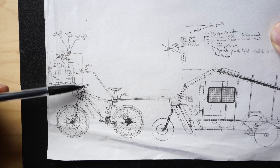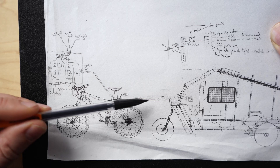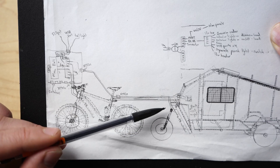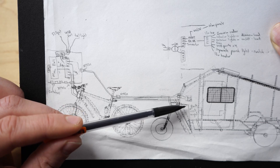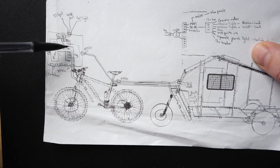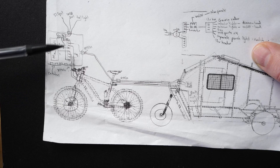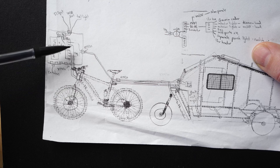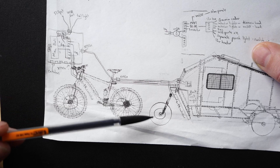The wiring will run along the crossbar to the connection point above the hitch, then all the way back to power the Frankenrunner controller, which powers the CyberDrop front hub motor. Also splitting off the same circuit, I'll feed into the CyberDrop another step-down converter for the 12-volt system in there. The second circuit will power the front Frankenrunner controller and the front hub motor. The gauge for both of these circuits will be 10-gauge stranded copper silicone wire, which will be plenty big enough to handle the amperage — I don't anticipate running more than 40 amps to each hub motor, so no more than 3,000 watts per motor.